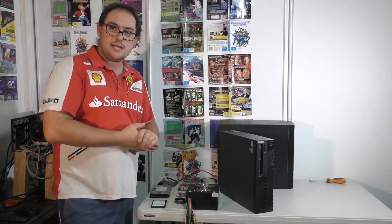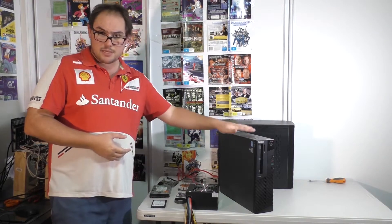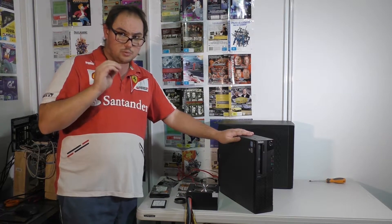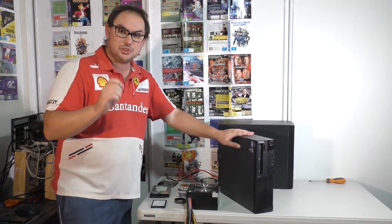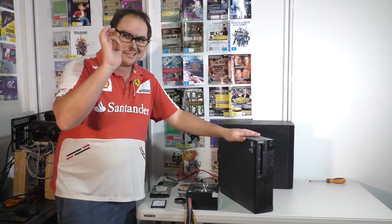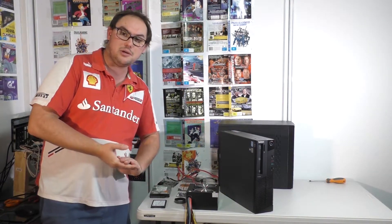On the RAM side we'll be running 16GB of DDR3. We'll also be running a 120GB SSD as a boot drive and a 1TB hard drive for storing all of the streams we're recording. The CPU is an i5 2400 — when a PC's only purpose is streaming, you can get away with a second generation i5. I've actually done a streaming PC with a Q6600, which was pretty amazing. With the little i5 in here we'll be golden. That's the master plan — gut this guy, put it in this case, and we've even got an OEM Windows 7 Pro licence to reuse. Let's go ahead and get this built.